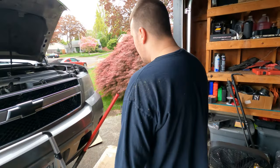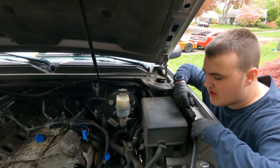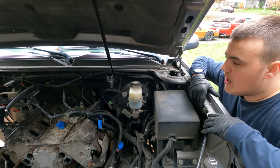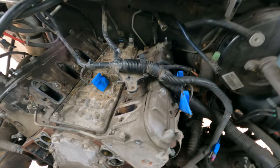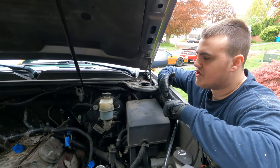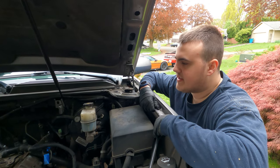You want to tell us where we left off? Yeah, so we took all the accessories off the front of the engine, took the crank pulley off, basically moved the AC and power steering out of the way because that's staying with the car. We left it at that with most of the electrical plugs unplugged. The stuff on the bottom of the engine still needs unplugged, but everything else is still bolted — engine mounts, transmission, and converter bolts are all still in. We're about to tackle that.